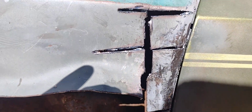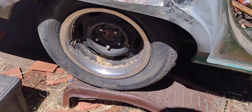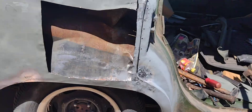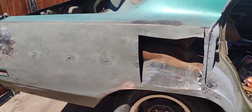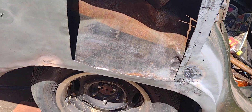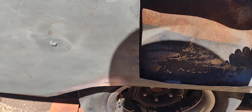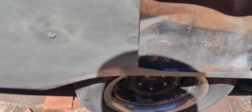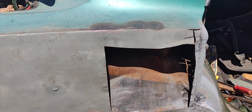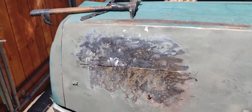It's not going to be perfect, but I've got the line pretty good. This door still needs to be adjusted and there's kind of a gap at the bottom, but I think that's going to be okay. I have this just about where I need it to the point where I can start closing it back up. The piece that came out — I'm not going to try to put that piece back in. I was watching Fitzy's Garage and he showed how to put a piece of panel in — he does an angle cut and welds it as he cuts it. I'm going to try that right there because that's a pretty straightforward spot.